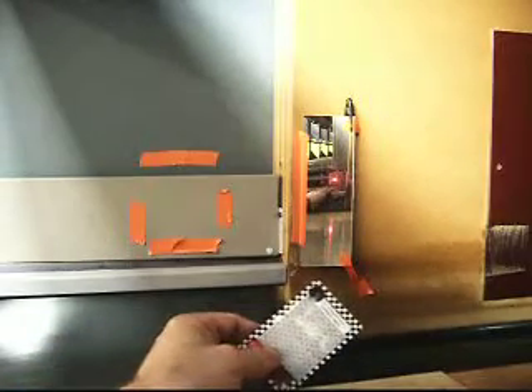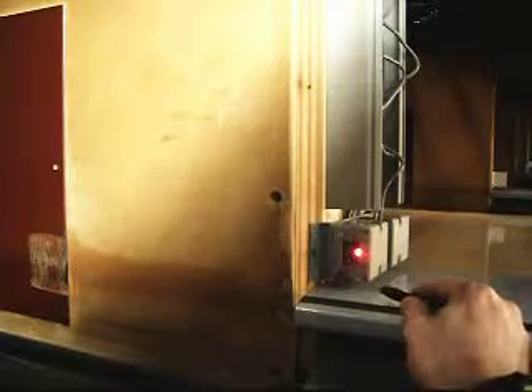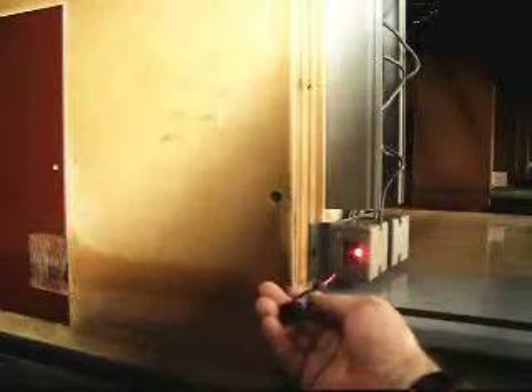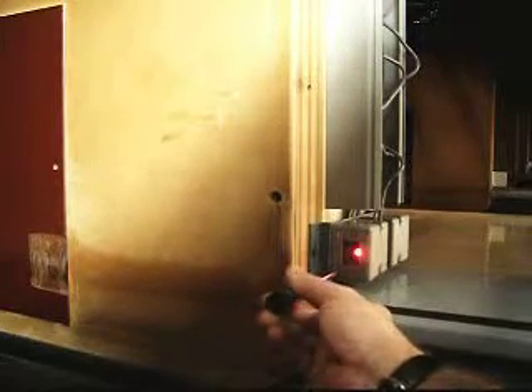Now what I'm going to do, instead of tightening the front screw, I'm going to equally loosen both of these screws that are closer to the kick plate — probably about a quarter turn. Because I want the beam to move equally. If you just do one or the other, it's going to tip the beam up or down. So now let's go back and see what we got.